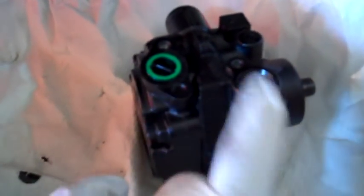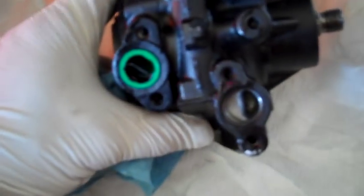This is actually the new unit. I grabbed this to show you that there are two mounting holes for this power steering pump — one on the bottom and one on the top — and I can tell because of this little feature right here. You can see that same feature on the one that's in the car. The two lines that are going to connect on this thing are here and here. After you remove those two mounting bolts, you'll also need to remove the four bolts that hold those lines in. Those two mounting bolts on the bottom and top are 12 millimeter.